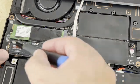Launch Rufus, select the GParted ISO, and create a bootable USB stick the same way we did before. Once the bootable USB is created, power down the machine. Power back on holding the Escape key to get the boot menu, then choose the USB to boot into it. At the GParted welcome screen hit Enter. You may get a keymap prompt — it typically picks it up automatically, so just hit Enter. Select your language if prompted.